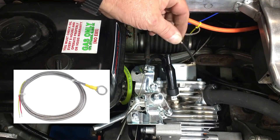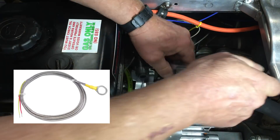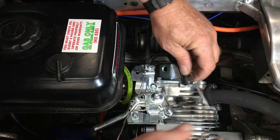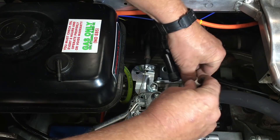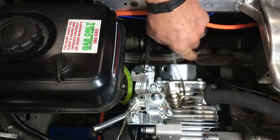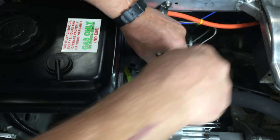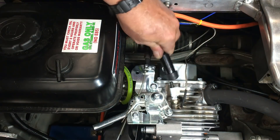Because we're in uncharted territory, the car is fitted with a few thermocouples to monitor temperatures. This thermocouple fits under the spark plug and gives us a reliable point to measure cylinder head temperature. In the first video of this series, we ran the car with a box-stock Predator engine — the link is in the description. Due to the placement of the fuel tank and exhaust system on the stock engine, we had to run the car without a hood. The stock engine ran about 220 degrees Fahrenheit, or about 105 degrees Celsius. We pushed that engine pretty hard but it never really got hot. This engine fits under the hood without any issues, so it'll be interesting to see if it runs any hotter.